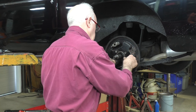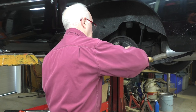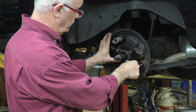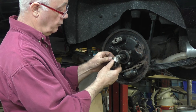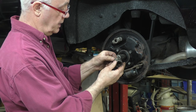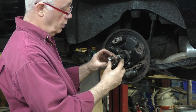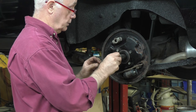Tap it in until it's seated properly. Now we have our seal set into the end of the axle and we've got it fairly flush. The next thing we're going to put in is the tapered collar. If you look on the collar, make sure the groove where the oil seal runs shouldn't actually be a groove — it should at most be a couple of thou deep. If you've got a deep groove in it you're going to have to get a new piece. Anyway, we just put that on — the taper on the end is where the hub will fit onto there, compresses this, and holds it onto the shaft a lot tighter.